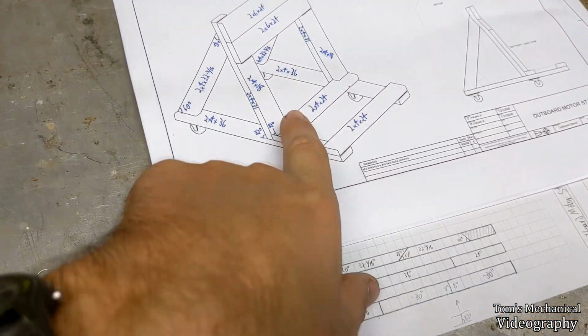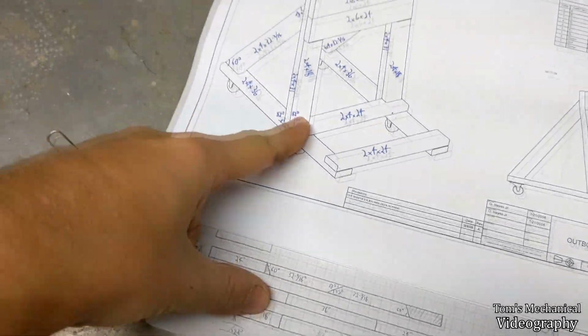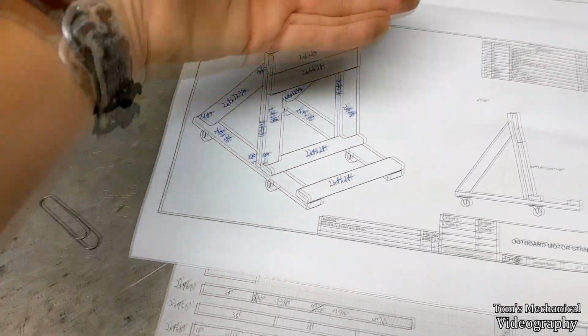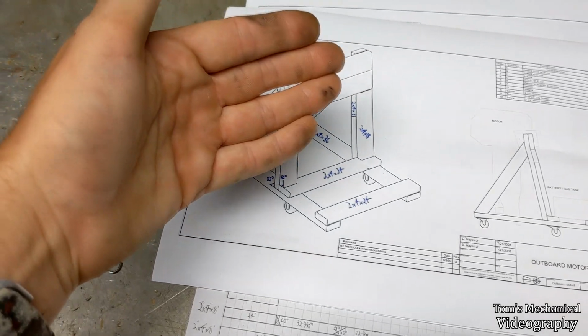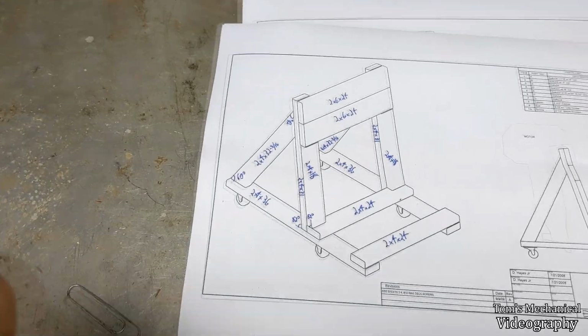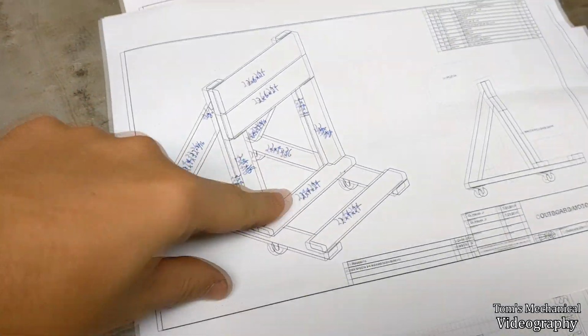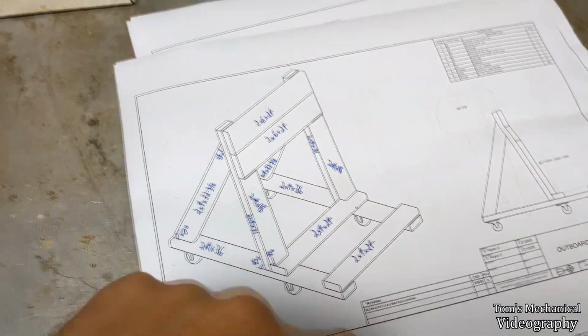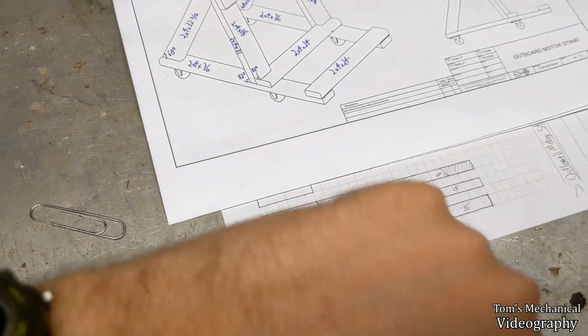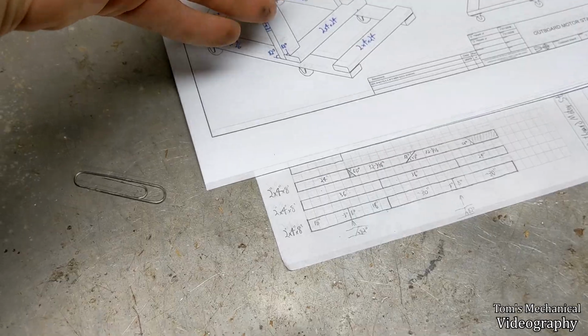Or alternatively, what you can do is take this board and a chop saw, set it at an 8-degree cant, and slice one slice at each end. Then take a handsaw or something similar and just cut at 3.5 inches to give you a cutout on each end, and then you don't have to plane the entire dang thing. Yeah, see, that's something that's done just to be fancy.